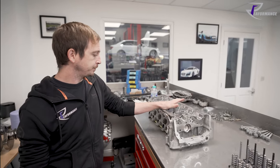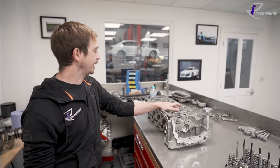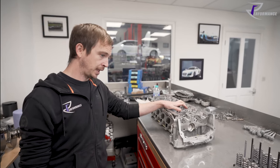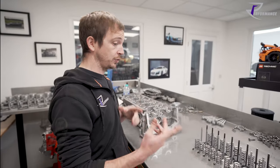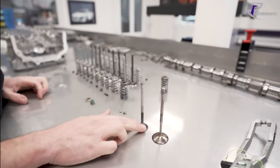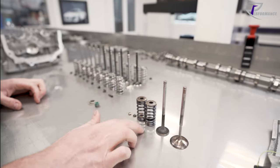The pump load is different for the DI. Other than that they look pretty close to the Gen 1 heads. Valve train, apart from one or two major differences, springs and retainers and that sort of thing are identical. So that's the stock inlet valve, that's the stock exhaust valve, and that's a pair of springs - springs are identical front to back.